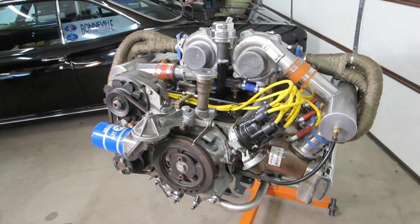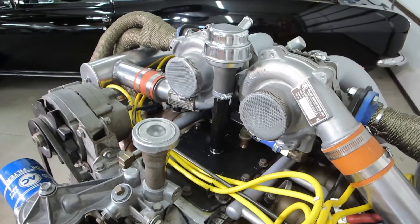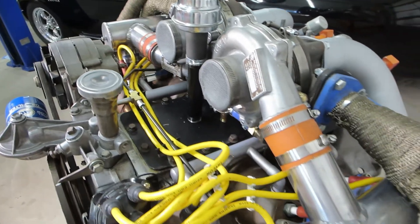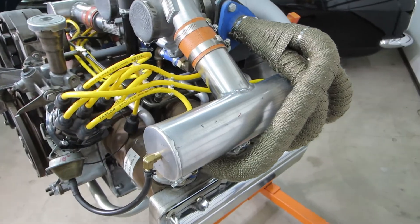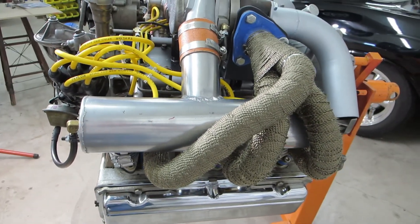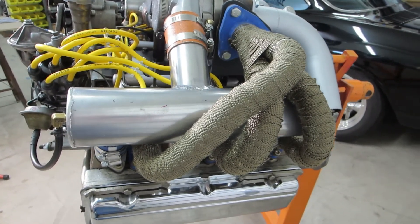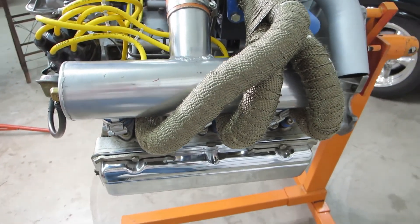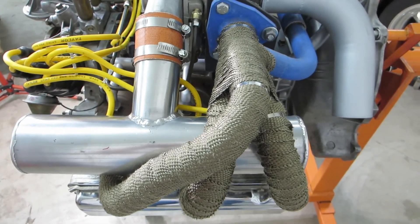Now we have an opportunity to take a closer look. It is dual turbos — these are the early model, the Model B flow, two of those. This is the exhaust and intake system. I use the plenums here on the intake and I try to use very short runners. Because both intake and exhaust ports are on the same side of the cylinder head, I can make a very short run. Three into one is the ideal way to do the turbos on the exhaust flow.